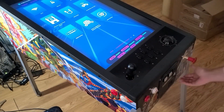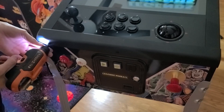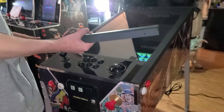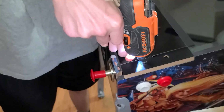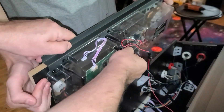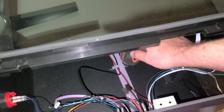To get started with the assembly, we'll first turn off the power to the Legends Pinball machine and unplug the power cable at the back. There are five Phillips head screws holding each side rail to the cabinet, so go ahead and remove all five screws. There are three screws on the front lockdown bar — remove those as well. Now remove the five screws on the opposite side, then carefully remove the three side bars and place them away from the cabinet. Some ALP models may have four screws holding the control panel. Go ahead and remove all four screws, then gently lift up on the control panel, being aware there are two wires connected. Disconnect the USB cable if connected, then pinch the haptic wire connector and disconnect that. You can now set the control panel away from the cabinet.